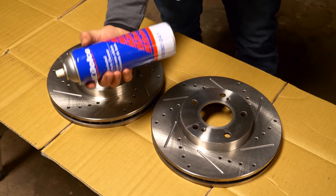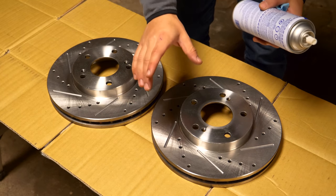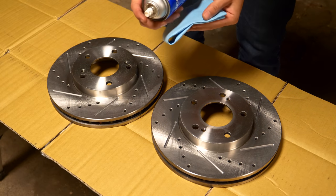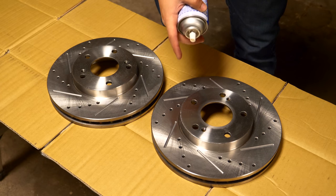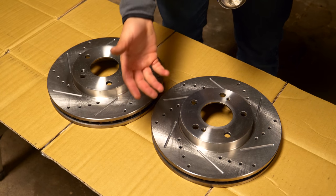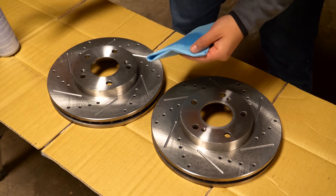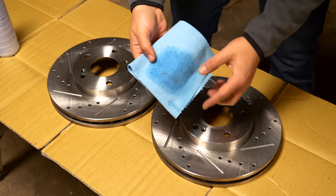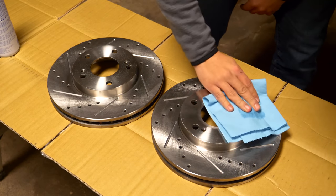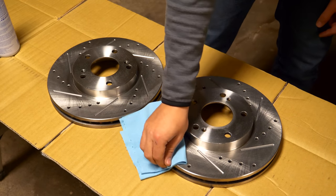I'm going to be painting up the rotor hat first so that it does not rust. Since these are bare cast iron rotors, if you just leave it like this and don't coat it in paint, it's going to rust out on you. I'm going to be using some brake cleaner along with a rag to clean up all the oil found on the brake rotor to prep it for paint. The brake manufacturer coats the rotor in oil to prevent it from rusting before it gets to your door. Spray a little bit of brake cleaner on a rag and wipe down the entire surface area — the contact patch, the rotor hat, and the backside. Do this even if you are not going to paint your brakes, to remove all the oil so it doesn't contaminate the brake pads.